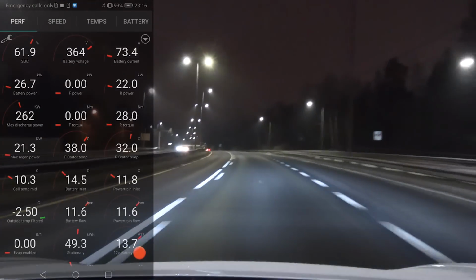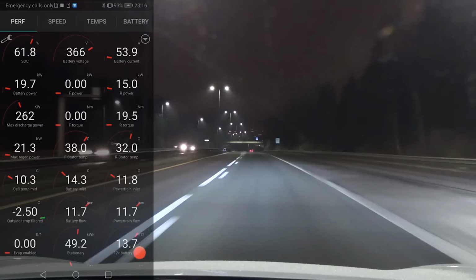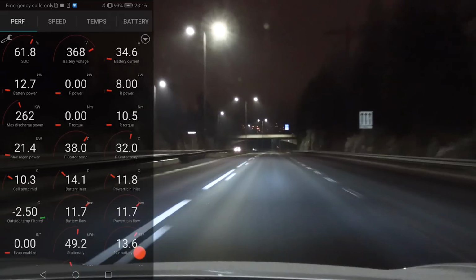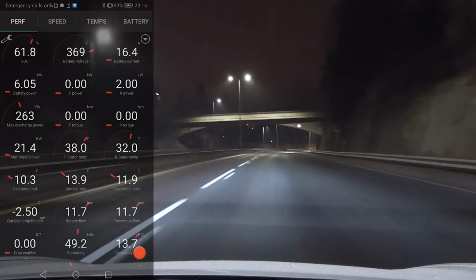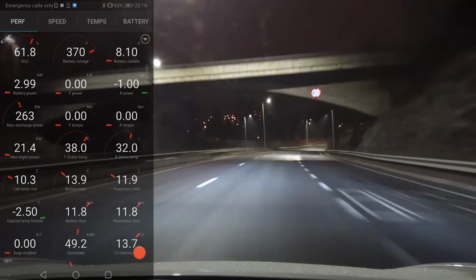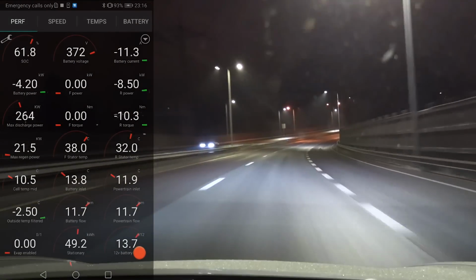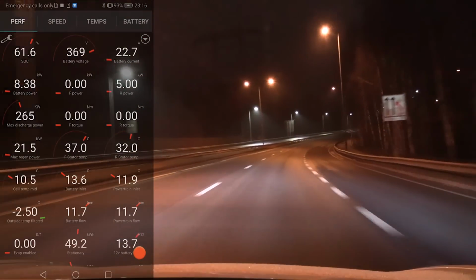They heat up as we drive, and the faster we drive, the more leftover heat they generate. And that leftover heat is redirected towards the battery. This is called heat scavenging. So in general, if you want to heat up the battery fast, you better drive fast. And I can mention that